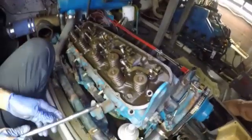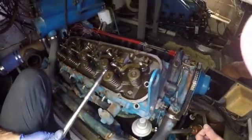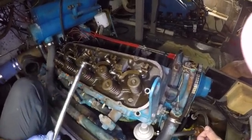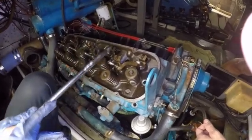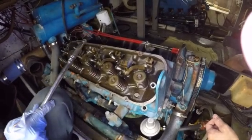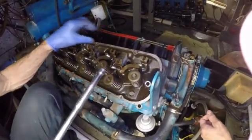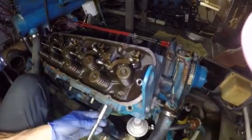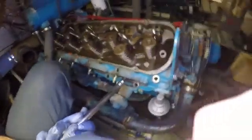All right, so live on the air again. We got all the cylinder head bolts off the passenger side. What's interesting is this is a passenger cylinder head, 049 head. And I thought the other cylinder head was a truck head. Oh wait, here we go. GM 8T. Maybe that's what I saw. Maybe they're both 049 heads. The 049 is not a horrible head. It's not a peanut port anyway. Decent casting.